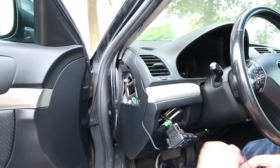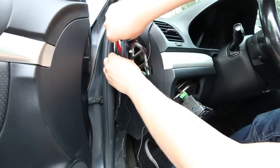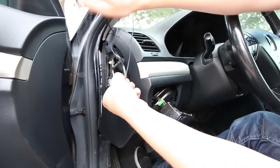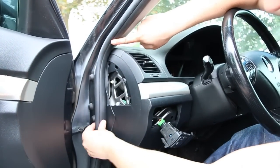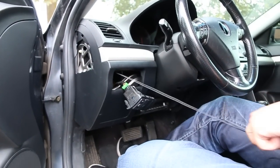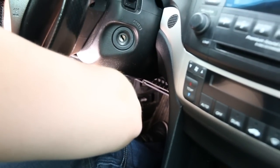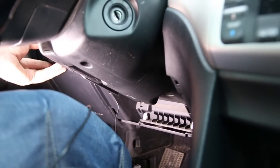Our main goal here is to get this wire behind the dashboard and all the way into the middle compartment which we showed you earlier. We're going to use our tool, and the main goal is to have it behind the dash so nothing is jamming the wire or anything like that. Then we're going to put the rubber piece back, attach the wire, put this panel back, and now we're going to show you from the inside of the car how to feed the wire through. We're going to continue fishing this wire behind the panels and behind the dash — we have the panel we showed you how to remove earlier. Now you can put the switches back at this point.